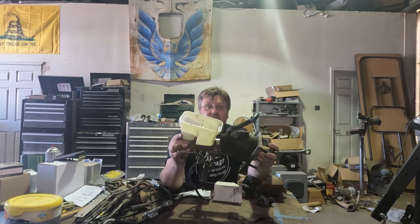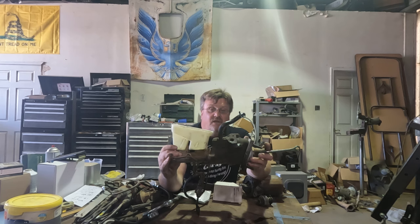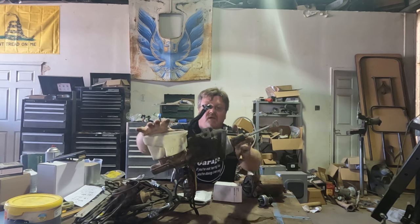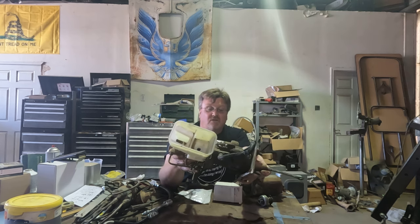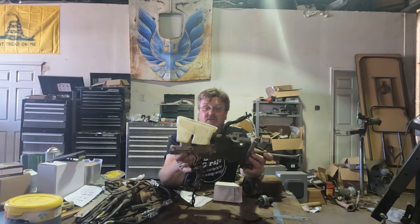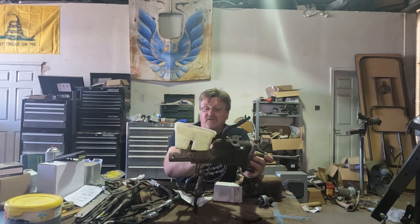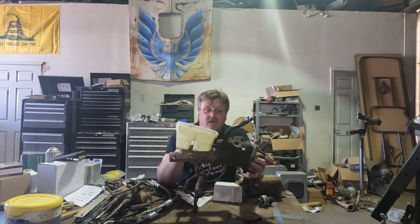I'm doing a little parts hunting. Now I've got a lot of junk on this table — some of it even relates to this project. One of the things is the wrong Hydro Boost. I was going for a Chevy Astro Van Hydro Boost — the early 90s one where it mounts to the firewall with a flat plate. This one is a later model with an angle plate. Also, this one was already removed and left open — all the ports were open and the master cylinder cover was off it, so I'm not even sure if it's going to work. But it was the only one I could find within 100 miles, and the price was right. Replacement units are like $100 or more, and $100 plus for brakes seems really excessive.